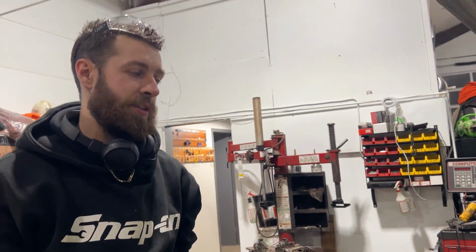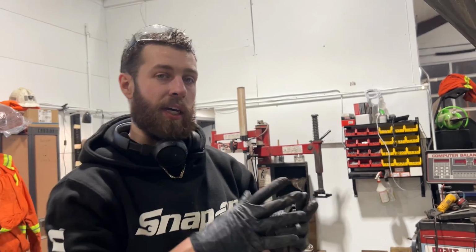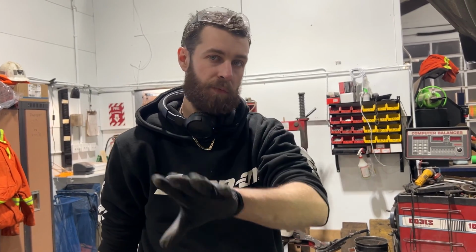So we're gonna do a little cooling system service on this 2013 Dodge Avenger, and the reason is because the vents only put out heat on like the driver's side, and then it gets cool. So it starts out hottest on the driver's side near the window, and then it's still pretty hot in the middle. Then the vent next to that is kind of cool. Then the one furthest away on the passenger side near the window is like cold.